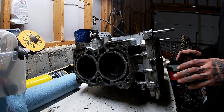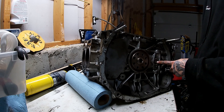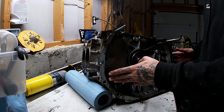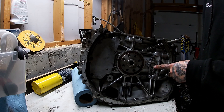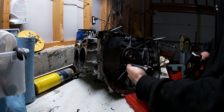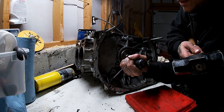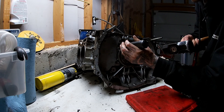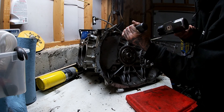Let's go ahead and get into tearing this apart — I'll walk you guys through step by step on how to split these case halves properly. This process is pretty straightforward. We're going to start with taking off this rear oil cover, this wrist pin cover, and then there's a couple wrist pin covers — one behind this and two on the front of the block. Let's get the impact driver and get this stubborn oil cover off. These can be kind of a pain — I've got a nice little mini sledgehammer here.